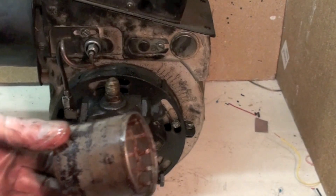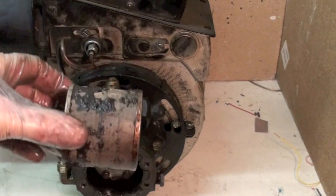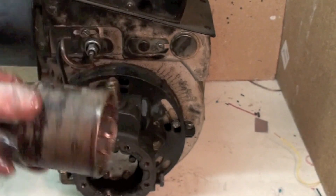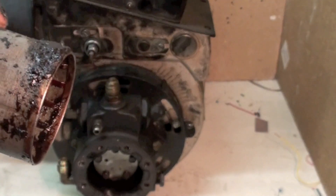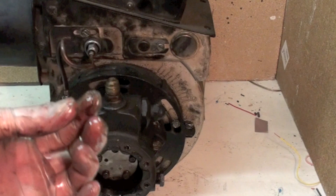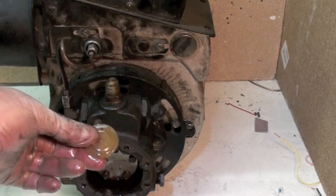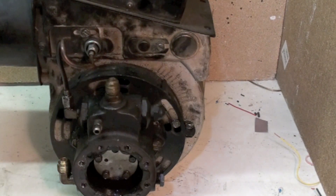Here's another screen - this one's been in for a lot longer, it's an older style. It actually seems like this one works a little better because there doesn't seem to be much garbage inside it, but we've got quite a few bits of sludge. If you can clean this thing go ahead and try it - this one still has plenty of room for the oil to get through, but clean it as best you can with hot detergent. It's pretty hard to get the sludge off very well, but this one is probably still salvageable. Underneath you're going to find this little component right in there - it may seem like there's no use to it, but it's a kind of pulse eliminator. A silly little thing - you'll work without it, but it does belong in there.